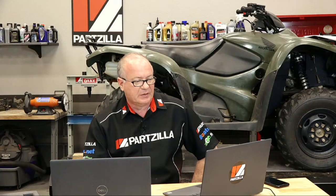Adam's asking me, I have a 2019 Grizzly 700. It's due for its first oil change. What oil should I run? Mineral or synthetic? Cheers from Australia. I prefer a semi-synthetic. I usually don't go full synthetic. Yamaha has a great one, and it's for the ATV and side-by-side market. Can't remember what exactly they call it, but I know it's in that gold bottle, so that's the one you want to look out for.